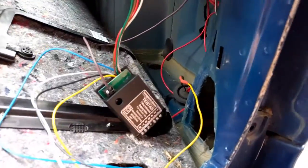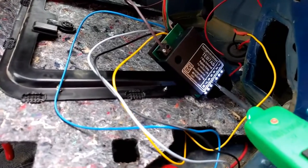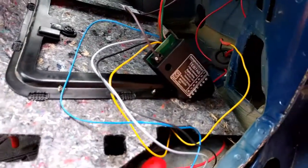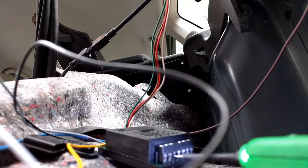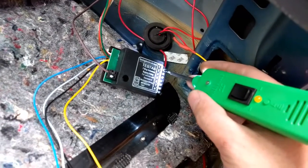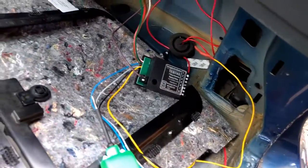At the moment we've got a power probe, we've got the tail lights on, so we should have a plus 12 on those with nothing else on. I'll set you up and I'll go test the brakes, and indicators too — you can hear the relay's clicking away. What have we got for relays? That's yellow number one. Yeah, there we go, all working properly.